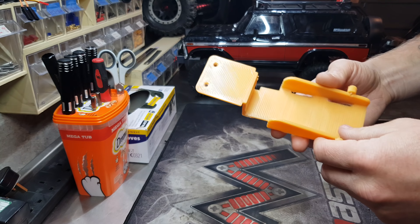This is the uphill test for the lower center gravity battery tray. The stock tray maxed out at 50 degrees, so I've set this to 50 degrees first. It's doing it — easier than the last one. We'll knock it up to 51. Nope — can't get 51. It's not much better on the uphill. It is better on the side slope, which you'd expect since the center of gravity is a lot lower — though the battery is still at the back which pulls it back a bit.